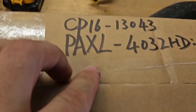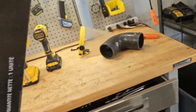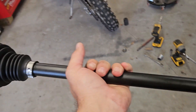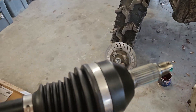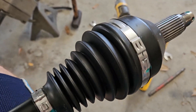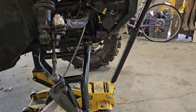Alright guys, it's here — the PAXL4032HD, I think that's the axle I ordered. Let's see what we got in here. Pretty box. This thing is beef — way beefier than the stock one. These Demons are so huge for the price, it is completely insane. I won't be breaking this one; I'll probably break the other one now. Very heavy axle, super tough boots — that's what I love about these. They're OEM-style boots, so you're not going to upgrade your axle and then ruin it as soon as the boot tears with contamination. These are also double plunging for the Pioneer 1000, which is super cool. If you ever want to do a lift, I could lift this thing a lot higher and get a lot more travel than the factory axles because these are double plunging.